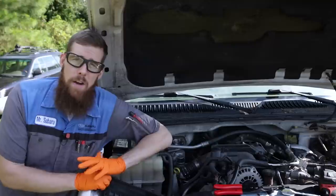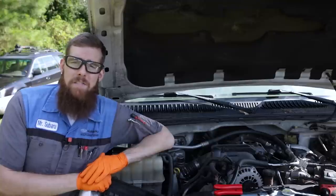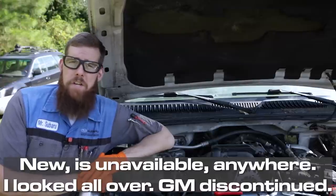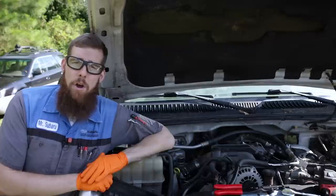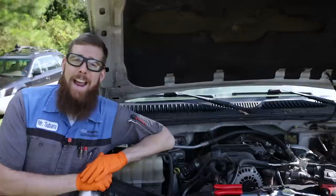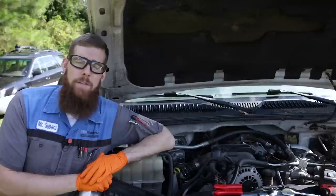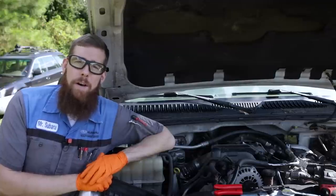So that wasn't my issue, and now it looks like we're going to have to replace the fuel injection control module on this truck. A new unit is about $1,700. You can send it off for about $250 to have it rebuilt from various rebuild services, and you can find remans from $600 to $800 — not a cheap repair no matter which way you go. I've seen YouTube videos of people opening these FICMs up, and it looks like there's a trio of capacitors inside that are notorious for letting go. So, being the cheapskate that I am, we're going to remove the FICM, tear it apart, see if we can find what actually shorted internally, and try to fix it ourselves to save a couple hundred bucks — hopefully.